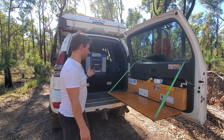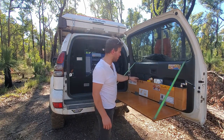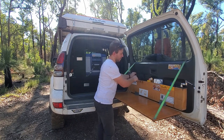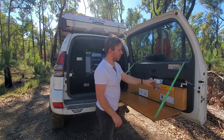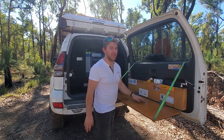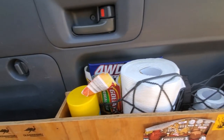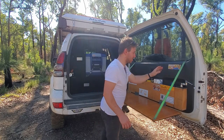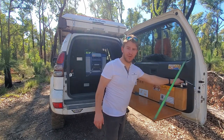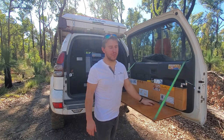Out the back set up for camp — the table I built myself from 12mm ply with a box section around the back, compartmentalized so I can still access the factory tool kit. Instead of the factory bungee cord storage, I use this section for things like cooking spray, snap-lock bags, paper towel, area guards, rubbish bags, and toilet paper. Back here I have my switches — one for the LEDs inside and out, and one for the onboard water system. I swapped out the old plunger-type water pump for a 12-volt pump which is much faster and less annoying.